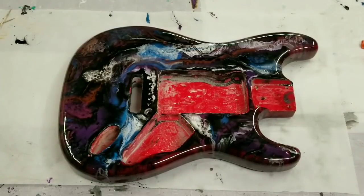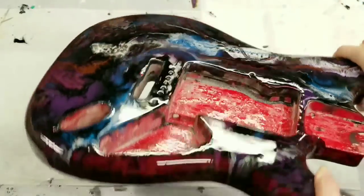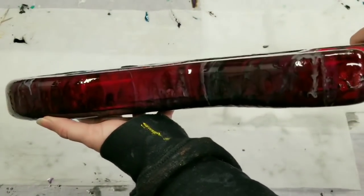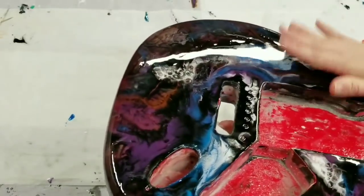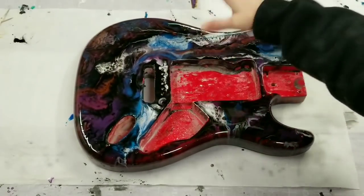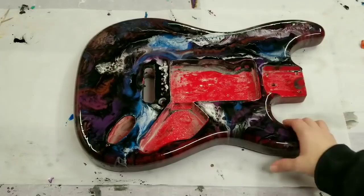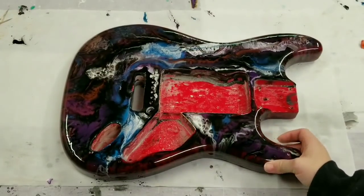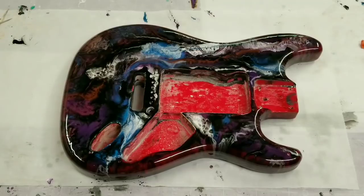Alright guys, so we're back. This will be the end of part three. This is how the front dried — much, much better, I think. And the sides go together a lot more now. So now all we have to do is our clear coat. Earlier in this video we already sanded the back here. We're going to just sand a little bit along the edge, and then we're also going to sand the front down again, just so that our clear coat will stick. This time I'm going to start with a clear coat on the back instead of the front. Yes, I've learned a lot. At the end of part four, I will do a whole list of everything that I learned doing this project and what not to do. But anyways, that's the end of part three — we'll see you guys next time in part four.